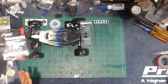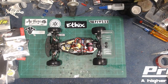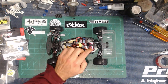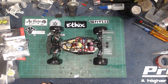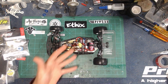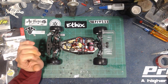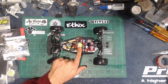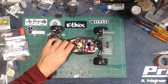Let's talk about the stuff that I have done to this car. The only reason why I'm going to tear it all apart is because finding this brushless system right here is pretty hard right now. If you want to race, bash, and go fast — which everybody does — that is going to be one of your most important upgrades: replacing the ESC. It's going to free up a lot of space and allow you to use your own remote and receiver. If you have a Spektrum you can bind to this, though you will have to use a separate Spektrum receiver. We also have the 800 milliamp battery in here and I replaced the connectors with XT60s for easy charging and a little bit better amp load.